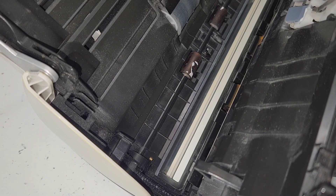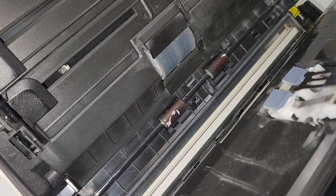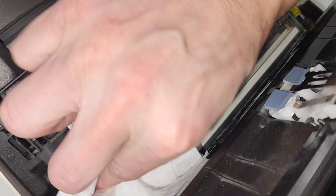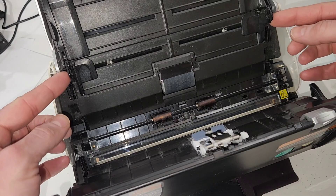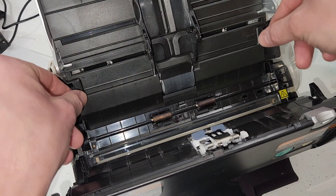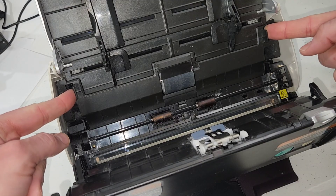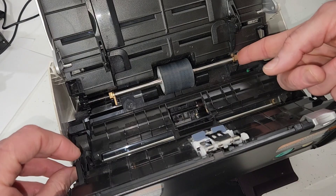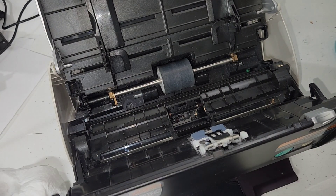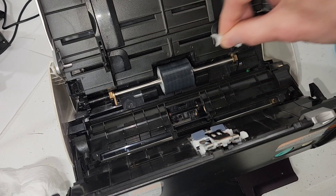While we're at it, let's go ahead and clean the rollers. Spray some window cleaner — make sure it's not too wet — and you can just go ahead and clean. This whole area has a little bit more dust than it should have. So go ahead and wipe everything down. What you can also do is move these guide bars to this section right here. If you move it too much to the middle, then you won't be able to take this piece out. Press the two tabs right here and pull this forward — that gives you better access to the roller so you can go ahead and clean it. You can use an alcohol swab. It's very easy to spin it.